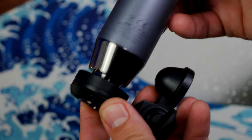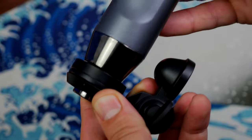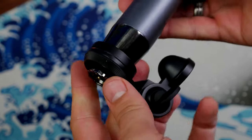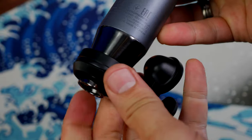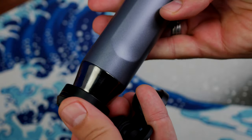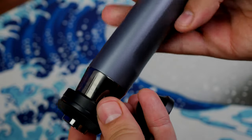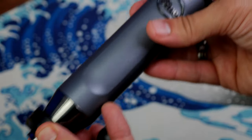You will need to tweak around with the settings in order to get it sounding good. The stand itself is a really simple sort of setup - it basically just screws into the bottom, and then you can adjust the wheel on there to move it around. You want to get it into a position where you can comfortably get it in front of your mouth and close enough. This is a balance you'll need to strike - get it close enough to turn the gain down to counter background noise, but not so close that it picks up all the wind and pops from your mouth, which is an unfortunate downside of this condenser mic setup.